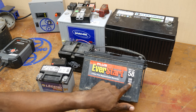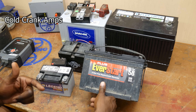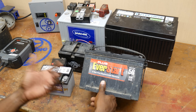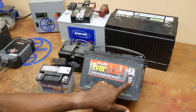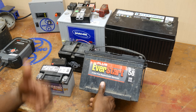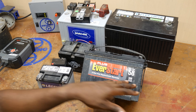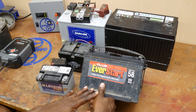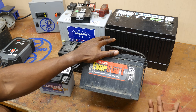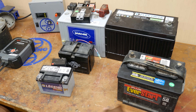Which leads me to number two: CCA, which stands for cold crank amps. Batteries that are cold don't put out as much power as a battery that's warm. The battery industry has come up with this cold crank amp standard, which defines essentially how much current the battery can produce for 30 seconds when the temperature is zero degrees Fahrenheit. That helps to compare one battery to another when talking about starting a car in very cold temperatures. In warm weather, it doesn't really make a difference. This one here has 550 cold crank amps.